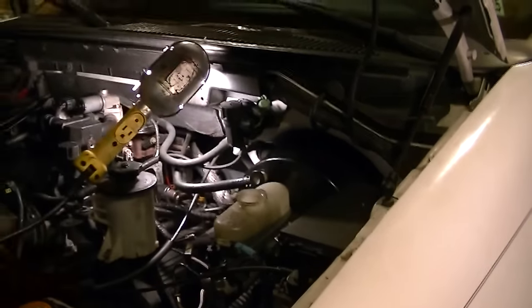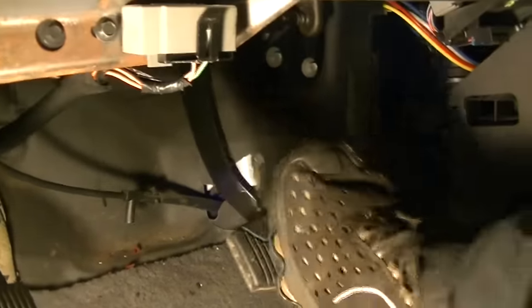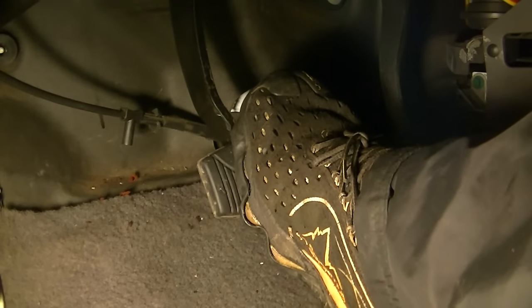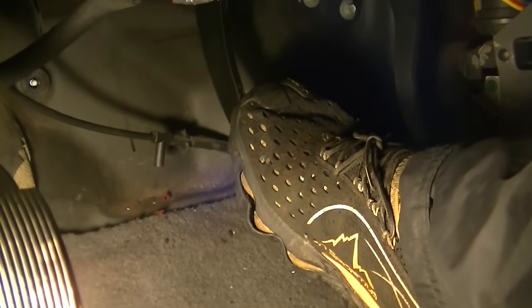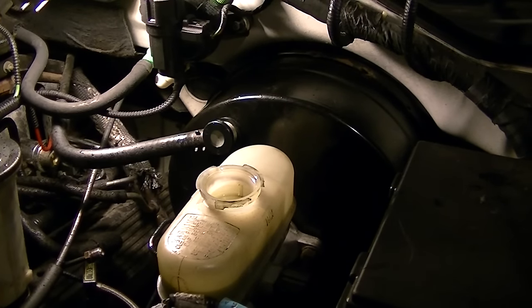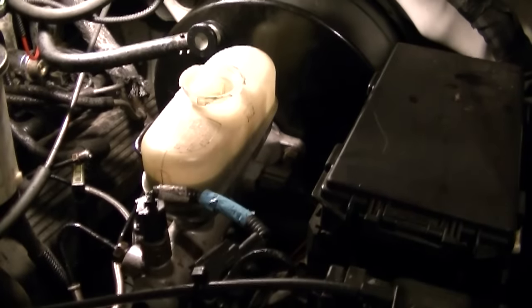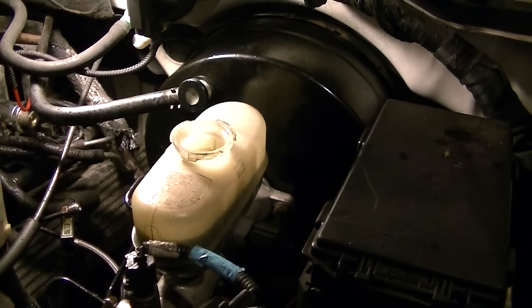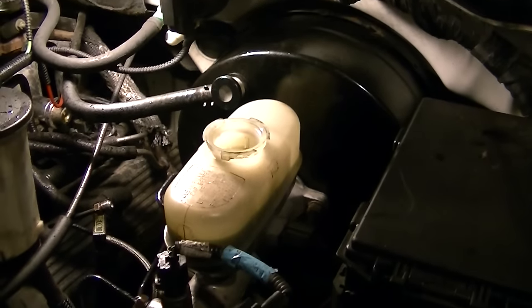As you can see here, as I continuously push on the brake pedal it goes all the way to the floor just about. I've never run into an issue where I could not solve a brake problem — brakes going to the floor after replacing the master cylinder, all four pads, rotors, bled the system by the book — still had the pedal going to the floor. So I decided to go hardcore and do a little inspection and some testing.